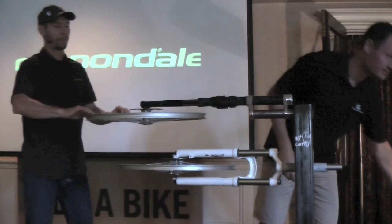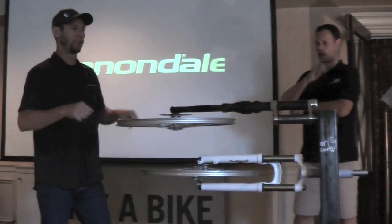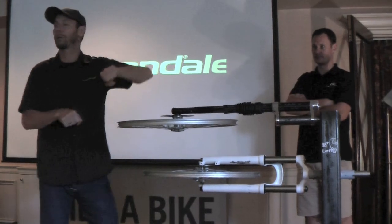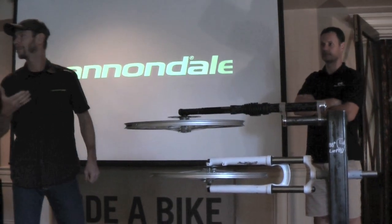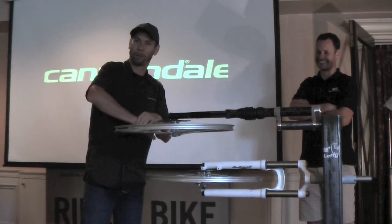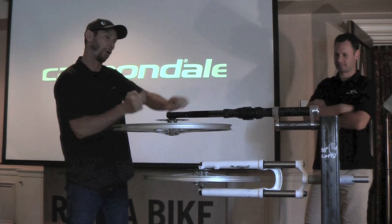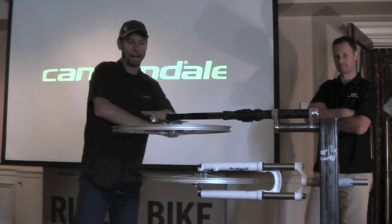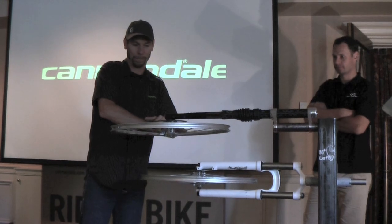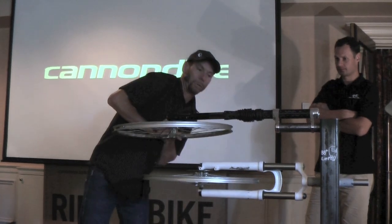Okay, so when you ride, the impact comes from here, you ride over bumps and so on. But when you go in turns, when you go in really sharp corners, your fork or your bike is going to receive forces from the side. It's the forces that are going to go against the wheel, the tire. You have some inherent flex in the wheel, that's normal, you can see it flexes a bit, but after that, you can see it's only the wheel, the fork's not doing anything.